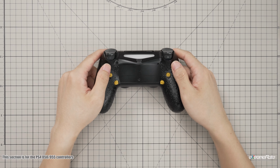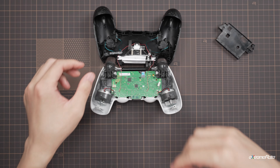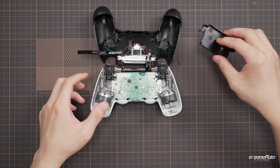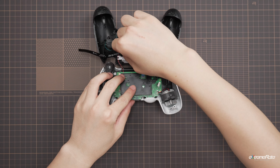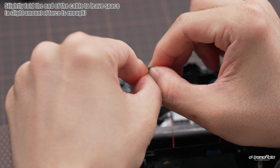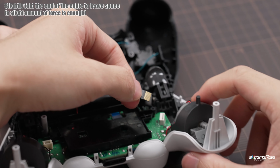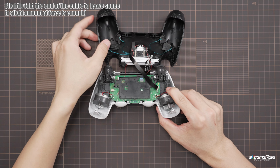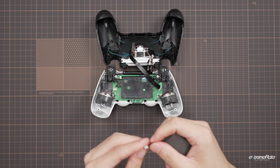If your controller version is 040, the cable connector should be on the opposite side of the FPC. Put on the battery tray first, and plug the cable to the connector. Then plug the battery cable and install the battery.